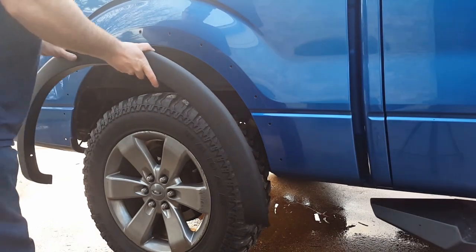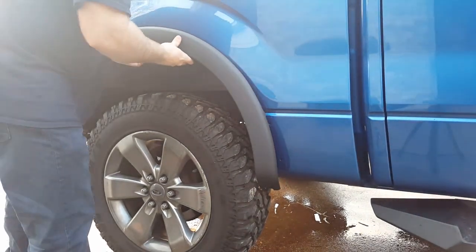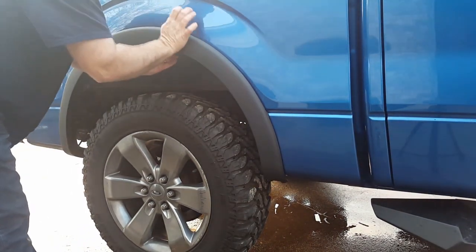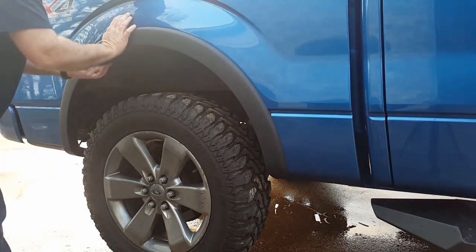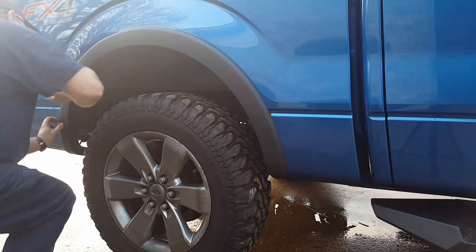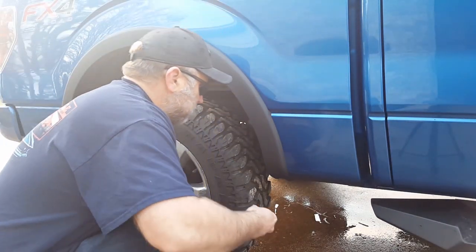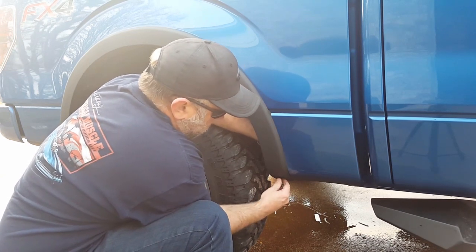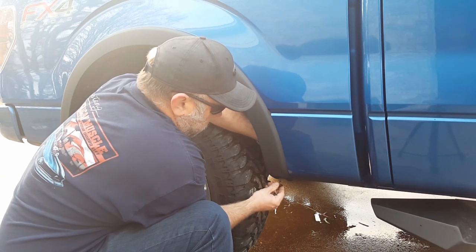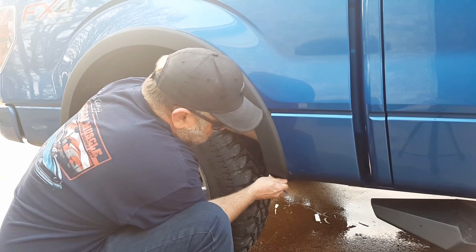And the rear ones go on pretty much like the front. This time you have two bolts. Let's go ahead and line up our tabs. Work our way down the other side. Let's get our impact and our two bolts. Remember, inside the fender here there's some supports. You're going to have to line up the support with the bolt hole, because the support has a blind nut on it. And that's what you are bolting. May take a minute.